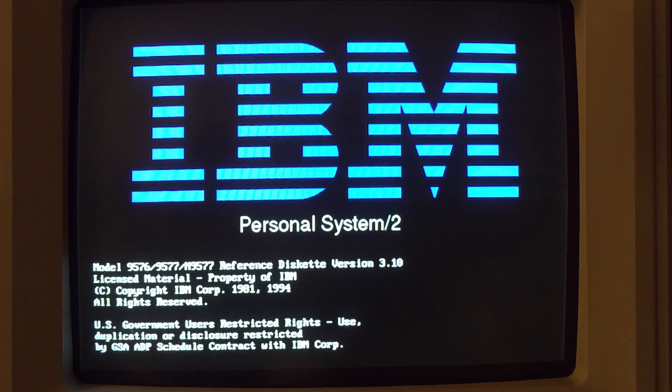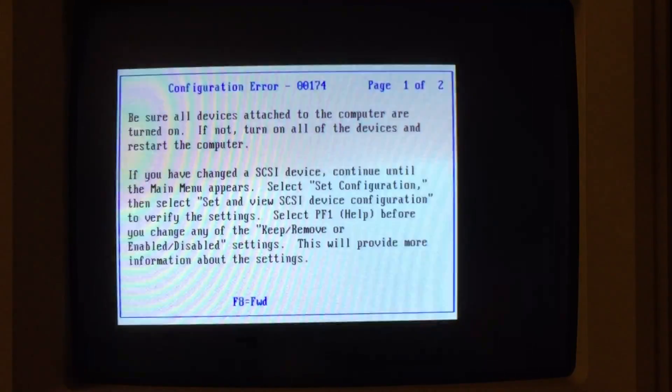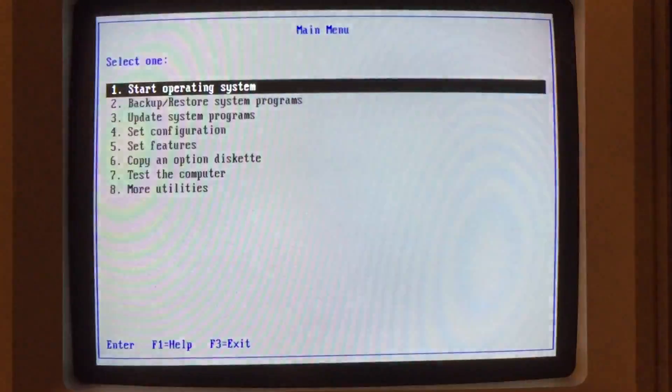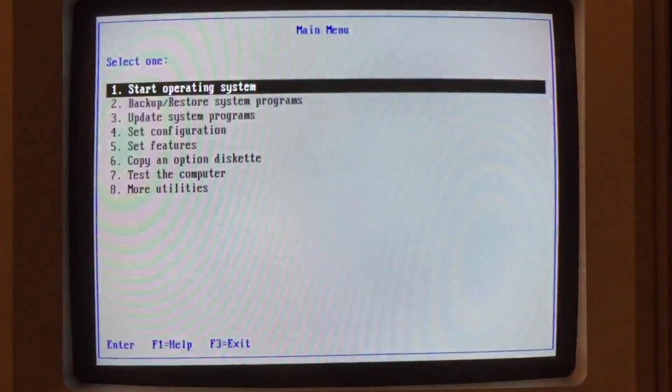With this machine, however, we have a little problem, because its BIOS code lives on the hard drive. If you replace the drive, you'll find the machine magically stops working. You have to somehow transfer the code from the original drive to the new one. It took a bit of research to find out how to do it, but luckily IBM made this fairly easy. Pressing Ctrl-Alt-Insert during POST with the original drive in the machine gets you into utilities that allow you to create special floppy disks. These disks are used to boot the machine and write the BIOS to a new drive. With that out of the way, the computer recognizes the SCSI to SD device and we're in business.